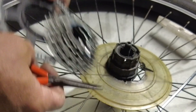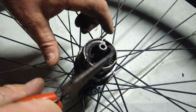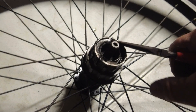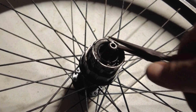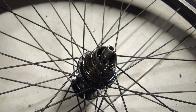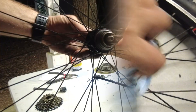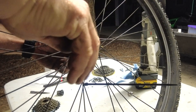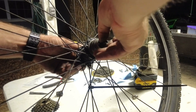Now that I've got that last piece ground off, I can remove all the chain rings. I finally have access to the piece of metal that was holding the bearings in place — you can see that the grinder cut it into several different pieces. The reason I went this direction is I'm hoping to remove everything so I have the piece of metal that screwed to the hub, and maybe I can get a channel-lock pliers on it. I'm thinking I can use a screwdriver in the notches I've created to turn it off, but first I'll have to remove the center hub from the wheel.